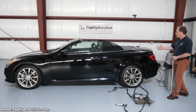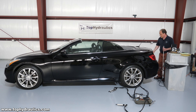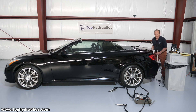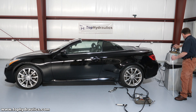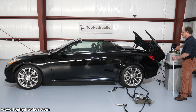So what we're going to do is raise the top. Obviously, first the trunk lid needs to move back. We've taken a little shortcut here — the release of the trunk lid in the rear is normally with a little solenoid, but instead of wiring that up, we just put a string on the emergency release cord inside the trunk and already unlatched the rear of the trunk lid. Just a tiny shortcut. So now we want to close the top. First, we retract the trunk lid — we turn the motor in Y direction, turn on solenoid number two, and this should raise the trunk lid. And here it goes — trunk lid raises, or retracts, put it that way.